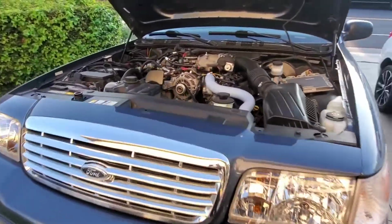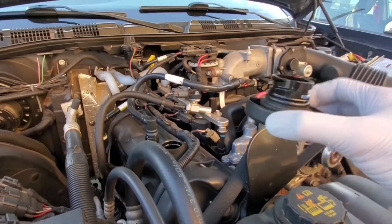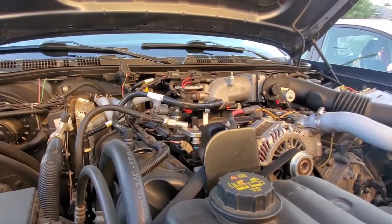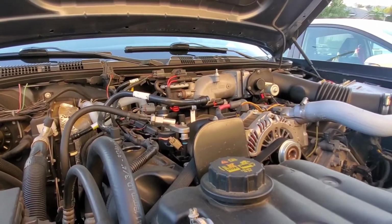And I don't know if it matters, but I like to take off the oil cap before I drain the oil, just to help the flow a little bit. And I also drive the car a little bit, get the car warm, so that the oil is nice and warm and will flow out better before I drain it.